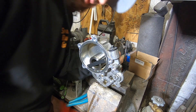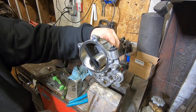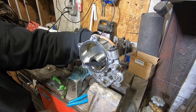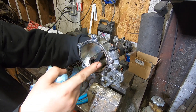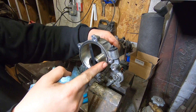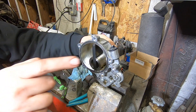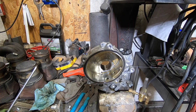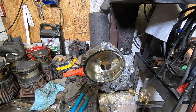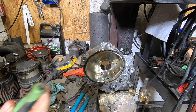Here's what the rotation of the pump looks like. It's got this wafer that slides back and forth between the shaft. You have a small amount of space here, and as it turns, the amount of space grows — this creates a small vacuum pocket that is distributed to the port. This pump is always wet with oil, or at least it should be. The oil does two things: it lubricates the pump, but it also seals it.